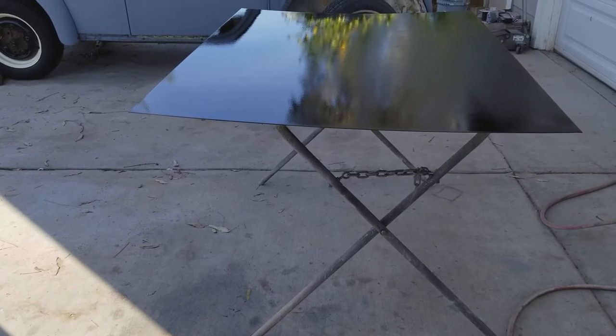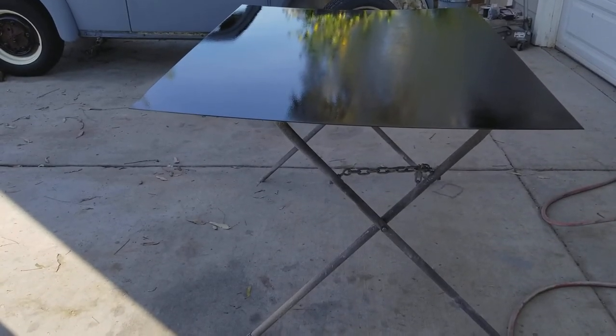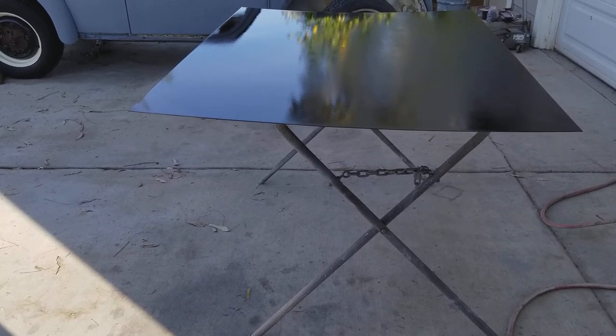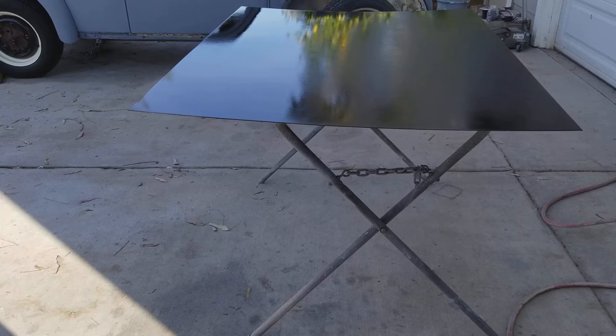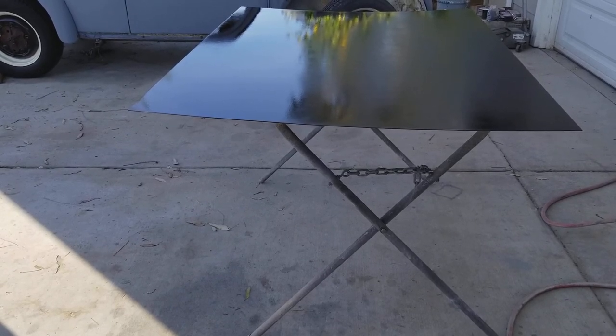While we're drying, the reason I use this gun mostly is because it puts out so much less overspray. This particular product is a 3-to-1 single stage urethane by PPG - the brand is Matthews - and it's ultra low VOC. It also won't travel more than about 20 feet and the overspray won't stick. It dries super fast, almost like lacquer. When it atomizes it dries faster than when it's on the panel. It's a satin black color and dries looking almost flat from certain angles.